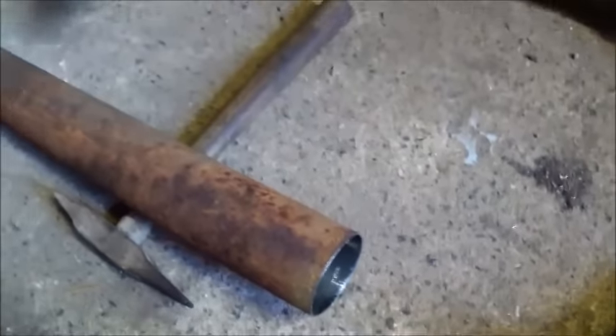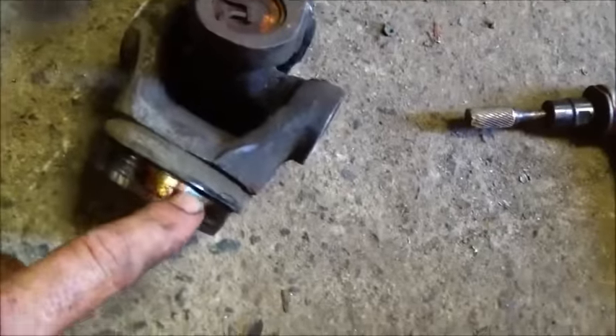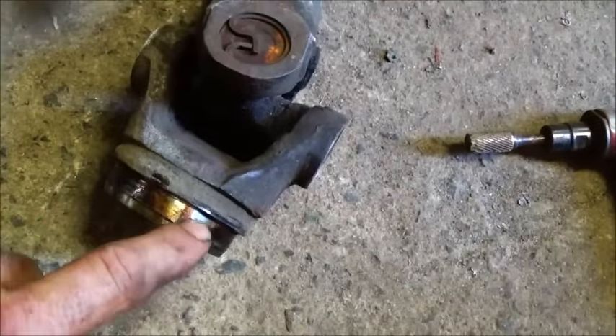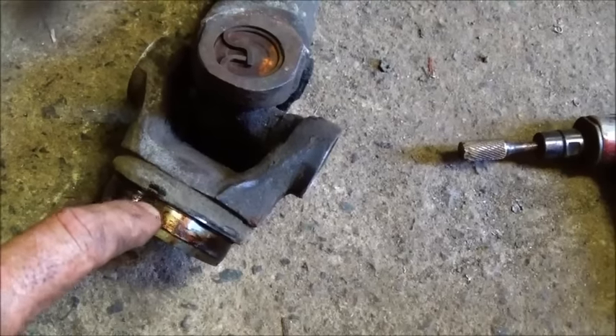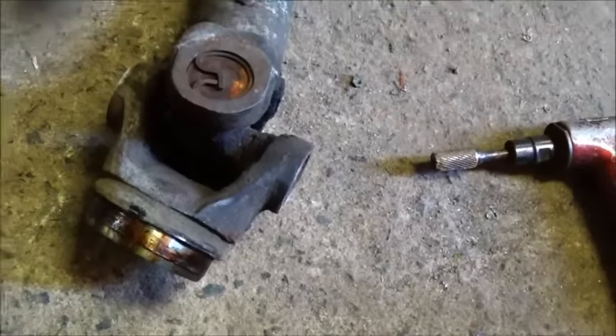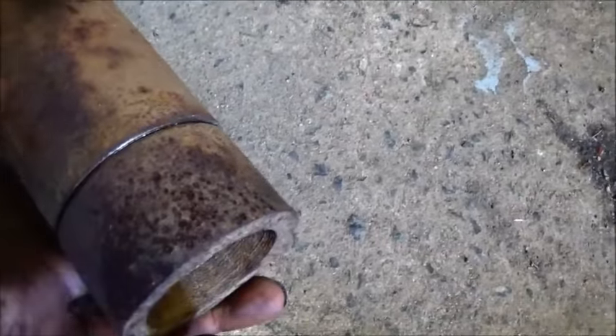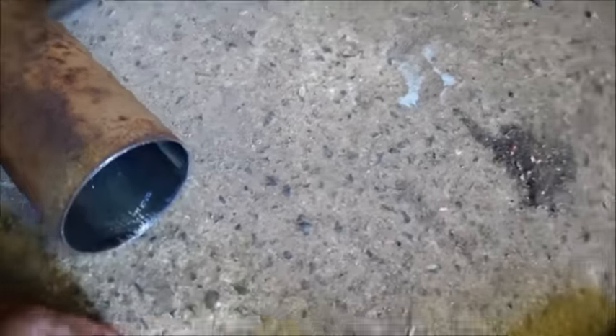Okay folks, I've got the driveshaft cut to the length I want. I remembered to get the tape on there so the caps didn't fall off. I've got this one cut right on the edge of the weld — leaves us plenty of room. That's probably three-eighths, maybe a little over three-eighths of actual flat, and then there's a taper, but that's plenty to get us lined up. I came up with this piece of steel — this was probably a weld-on nipple at one time, but it is steel, not cast. The OD of this is actually about the same as the OD of the driveshaft, and then the ID we can cut easily and get rid of these threads, or we can use the backside where the threads are not at.